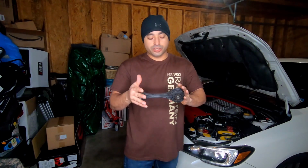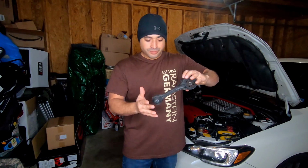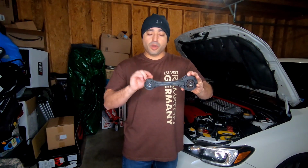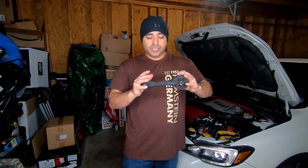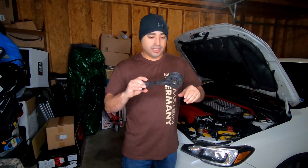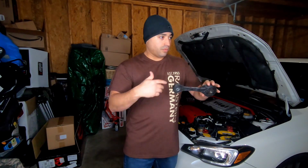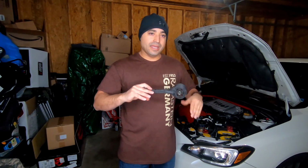So for some of you that have been having a problem installing the front end or the back end first, what I did was I started with the back, slid that into the mount, then I slid the front end. Don't put the bolts in first. Just get it to the slot where you think it'll fit through, and then do the back first. And then use one of the wrenches to wedge the front, push it back and forth so that it'll slide in.